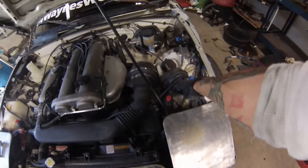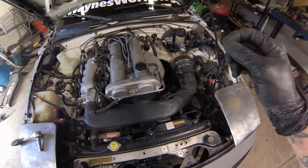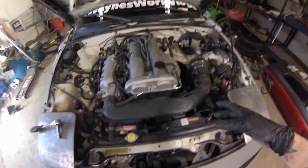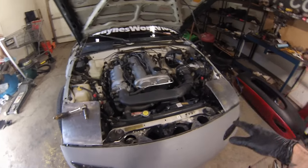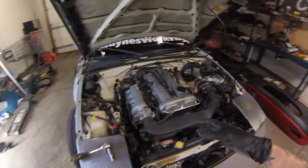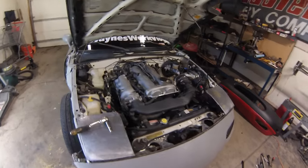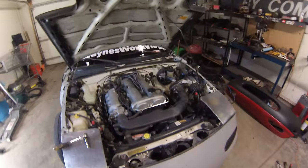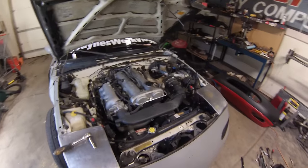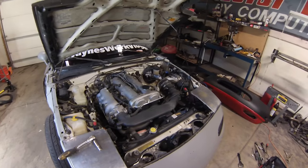I plan on doing a short ram intake with a downward filter, all aluminum tubing. I'm also going to delete the cruise control. Towards the end of the summer I'm going to do an AC delete and a power steering depower - google it, it's not the same as just taking the belt and hoses off. Flying Miata has a great write-up on it. I'm also getting rid of the breather tube so there's no crap going into the throttle body. Obviously I'm prepping for an LS1 swap so none of this stuff's important but I want it running as efficiently as possible. Comment, like, subscribe, share it on social media, and check out my free giveaway video.